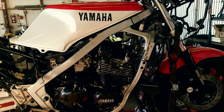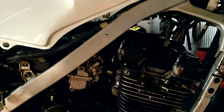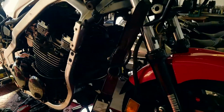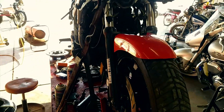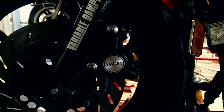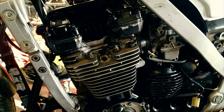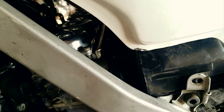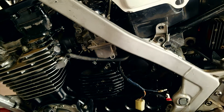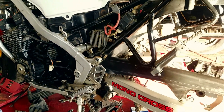Well, this seems like a good place to stop and give you guys an update as to what we've been doing here. Carbs are on — I've just got the tank resting on there, kind of fitting everything on. I still got to get the fender bolted up, put the brake calipers back on. Since they've been rebuilt, I do need to get some brake lines and brake pads. Got some spark plugs on the way. Unfortunately, the airbox boots are shrunken so bad and hardened so bad I don't think they're going to be very pliable.